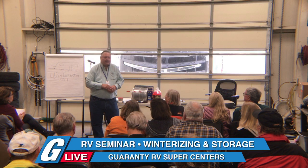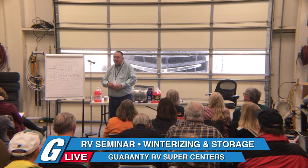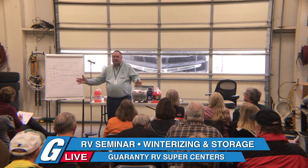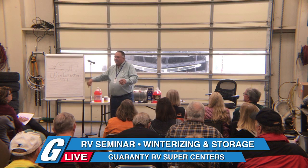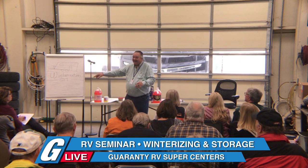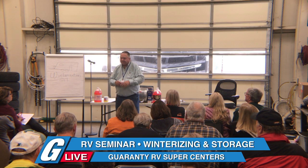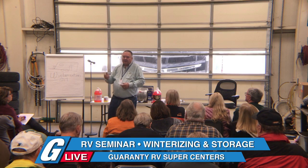The gentleman's question is, he has a Winnebago and they like to use Motoraid because they always have. And it's kind of neat stuff. Motoraid is in your engine, there's a T in the line to the hose that goes to your heat exchanger for your dash heat. So they run this hot engine coolant from the radiator back up the frame rail. I don't know why, but it heats the frame rail, but it comes out and goes through the water heater and a little bit here and there and back down the frame rail to the radiator. His question is, does he need to worry about that if he's winterized his coach?